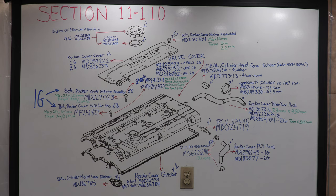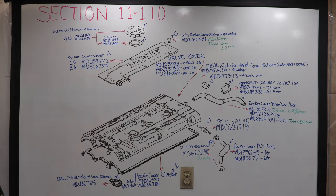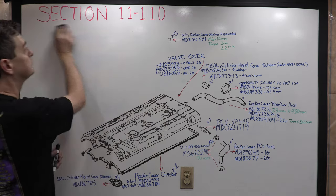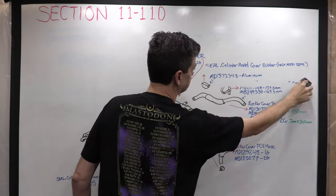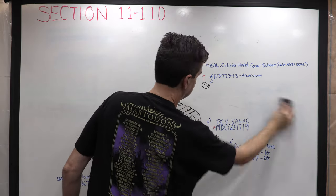When you last saw my valve cover, I was finalizing a modification that made half of it irrelevant for me. I have a coil-on plug system so that I don't have the plug well cover. I changed out my valve cover fasteners for blingy stainless ARP cap screws. I've got a blingy billet screw-on oil cap with an O-ring on it, so I don't need any of this. There's also no breather intake port on the side, so no other clip, no other hose, no other vacuum hose connection from that port to the intake snorkel.